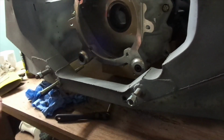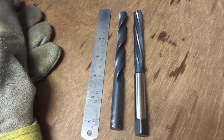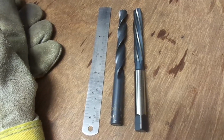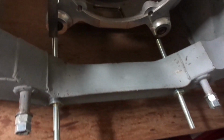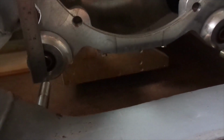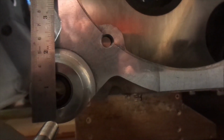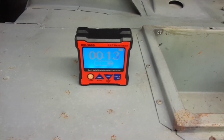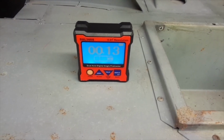Oh, yes. Right, sort out the other one. So, always remember, after a good reaming, clean your tool and your drill. Both bolts in, great. Put a ruler on there. Chassis does have to come up a little bit, so it's about 1.25 inches. Thought I'd check longitudinally how level the chassis wasn't. That'll do for me. So I do need to raise the chassis.